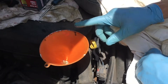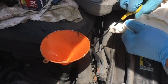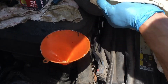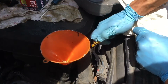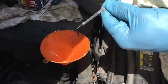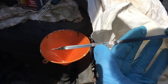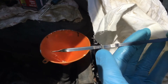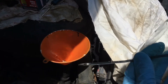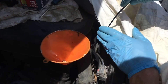We're on to the final step. After the engine has been filled with oil, check it using the dipstick. First, take it out and wipe off any old oil, then reinsert the dipstick all the way. Check your level — the dipstick will have a crosshatching pattern somewhere that tells you the range you should be in. If it's not in that range, you've got a problem: either add more or drain some out. And that's it — that's all there is to it. Wipe it off every time you check it, and you're back on the road with a successful oil change.